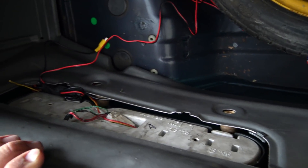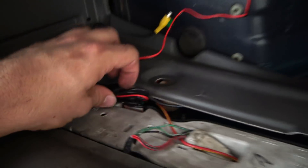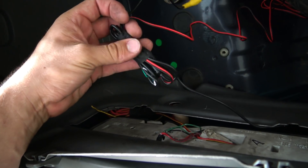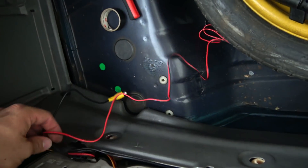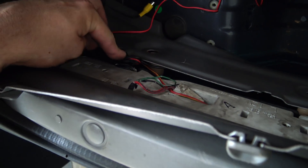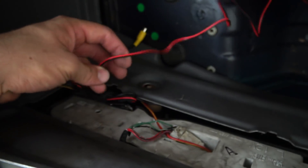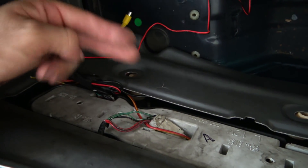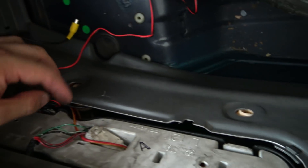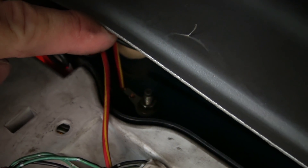Now the thing I can't stress enough, if you want to make the install look like a professional install, is making your cables neat. That's the cable running up — I've bundled it up. That's the excess from the actual camera lead and the excess from my little harness here. That'll be zip tied just here with the factory loom behind. Now when it comes to our powers, we've got earth and power — the power wire where I'll be running to here I'm going to cut to this length, then solder it on. The earth wire I'll be strapping just to there where we've already got a factory earth.